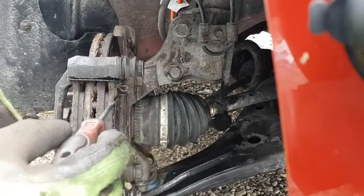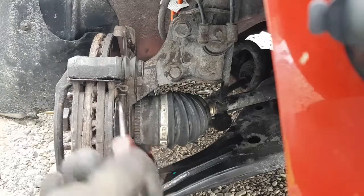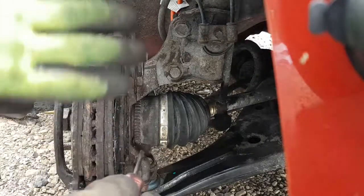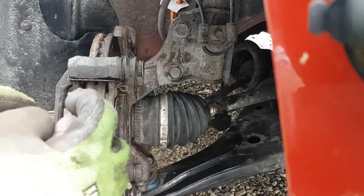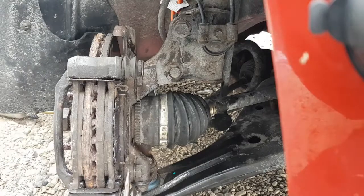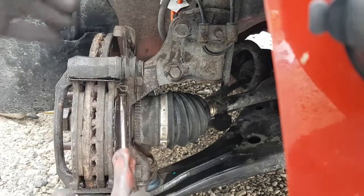The reason for that is when you're driving around town and your brakes are worn out, you don't need to get your brakes fixed the instant this thing starts making noise. You've got about 10% left once they start going off. But it's designed so that when you back up, it pulls this tab out and basically pulls it away from everything and makes a really loud, really weird noise. You can hear it right away, so when you're backing out of the driveway or a parking spot, you know, oh, what's that? There's something wrong with my brakes, right? But when you're driving to the garage, you don't have to listen to that noise the whole way there. So just make sure that they're on the leading edge of the rotor.